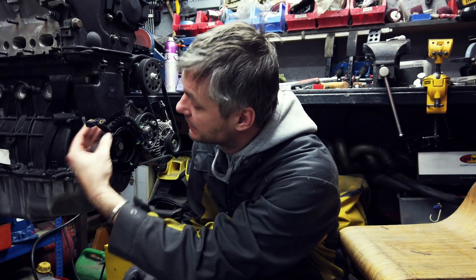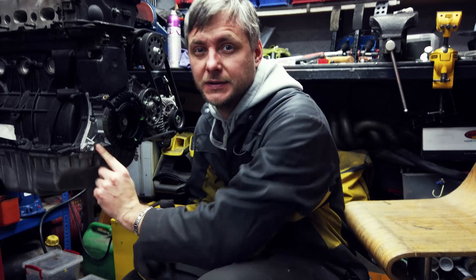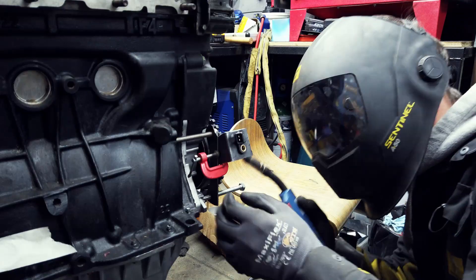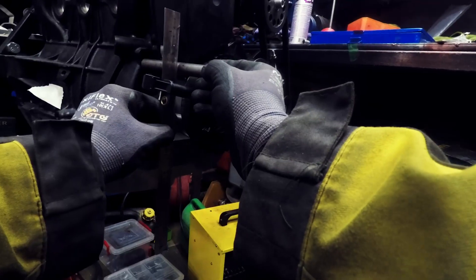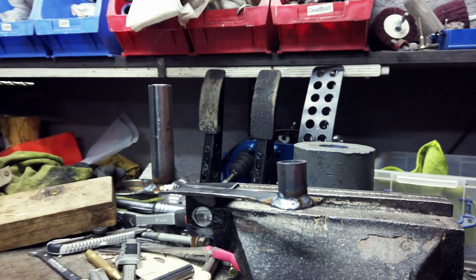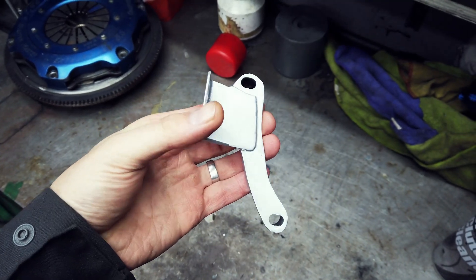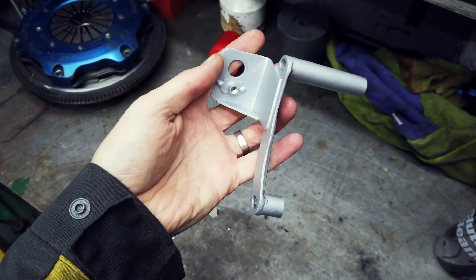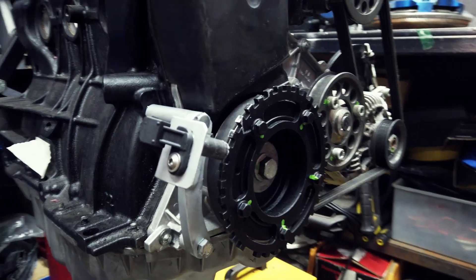So what I'm thinking — there's two unused holes, here and on here. All right, so we made a bracket for the trigger wheel sensor; it's nice and sturdy and actually fits okay. The gap between the sensor and the wheel is 0.8mm. I'm able to space it with these shims — they're 0.8mm shims. Do you enjoy watching what I do?